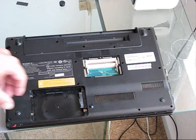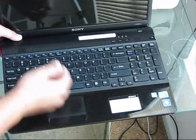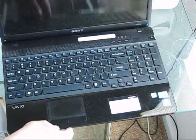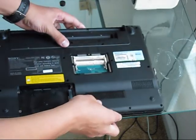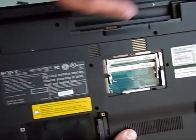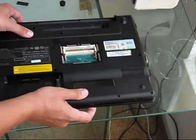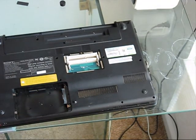Since right now we will be dealing with removal of the trims and the keyboard, I will first recommend to completely remove all screws that you see in the back — all of them. Just remove all screws from the bottom on this Sony VAIO, and then proceed to the next step of popping off the keyboard and the trims from the top.